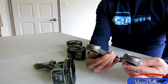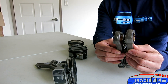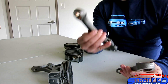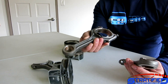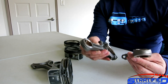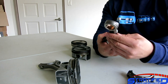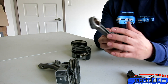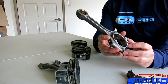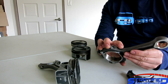We haven't tested the metals inside them to see how different they are, but physically and cosmetically they look very, very similar. Ironically, we see that the 2.0 will break a piston generally before it'll break a rod, and the 2.3 will toss a rod. One reason for this is unlikely to be the rod construction itself, and more to do with the fact that the 2.0 generally experiences less torque, having less displacement and a smaller stroke. The 2.3 has more fueling available, a larger turbo, and a larger stroke which promotes low-end torque — so we see those rods being cycled more often in the high torque regions. Cycling any metal beyond its infinite load limit will eventually fatigue it and you'll see a fracture.